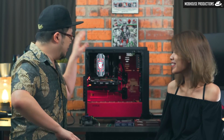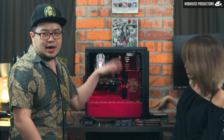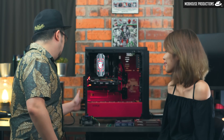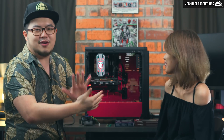So we are finally done! If you're wondering why I was so lethargic for the beginning half of this video, it's because I'm allergic to dirty PCs. Now that we've revamped this, you can see my energy level went out the roof! So today, what we did: we pimped her PC as best we could with the budget she allowed — which was not much — all under RM1,000. We flipped the three fans that were facing outwards in exhaust mode so they are now in intake mode, giving us positive airflow. This means more air going in than going out, which means all those little holes that used to suck dust inside due to negative airflow will now blow outward, acting like a valve so dust from outside cannot come in.